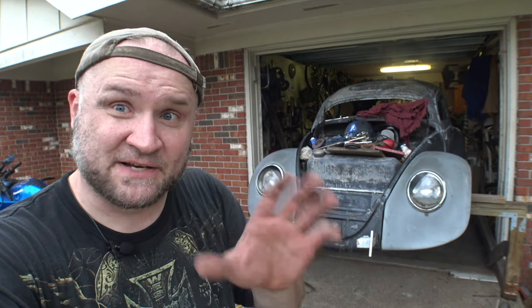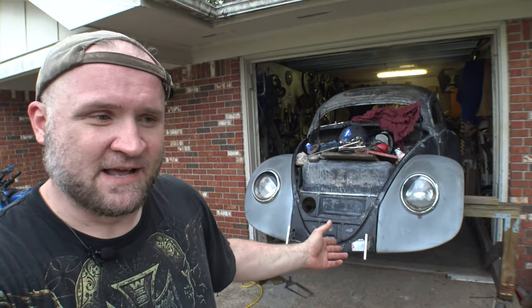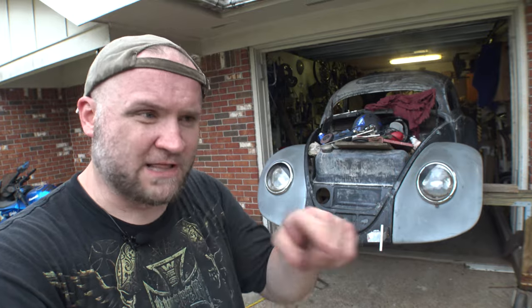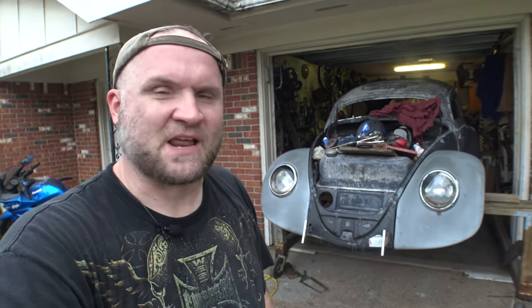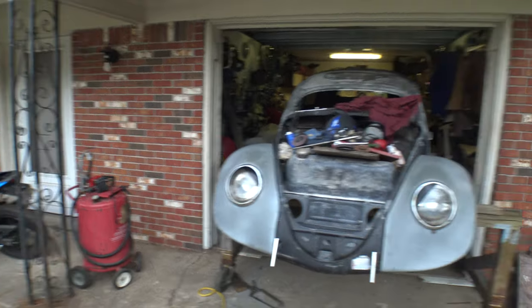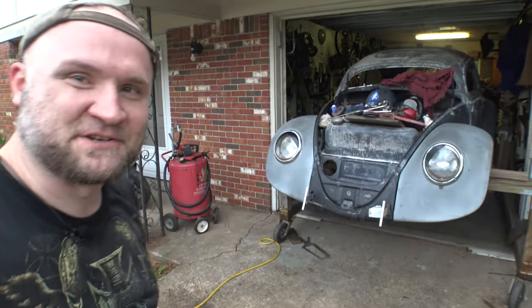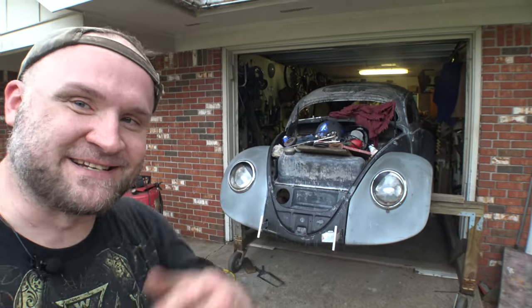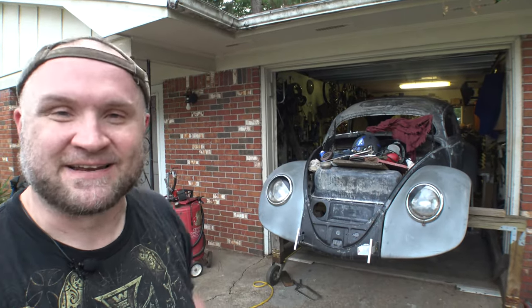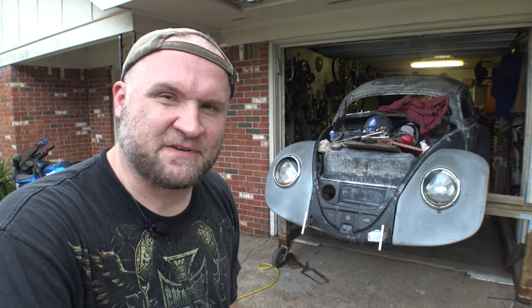But the thing that I didn't think about is that the brackets have an adjustability into it. So if I make the brackets a little bit crooked, I can still play with them on the outside. And even if for some reason there's not enough play in them, I can wallow out the holes in the bolt-on brackets and make them fit. So not the least bit concerned about it, not at all. But these T-bars are definitely bent. Definitely bent. I probably should have put them on opposite sides, but what's done is done. They're not staying on there anyway. In fact, they're gonna come back off because I still have to work down in the spare tire area. But that's gonna be a video for tomorrow.